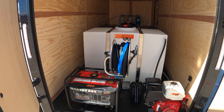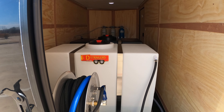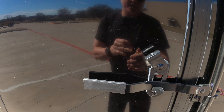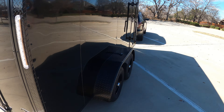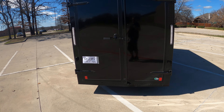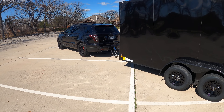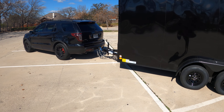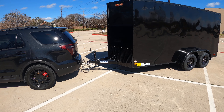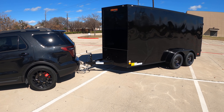This trailer you can probably tow with just about any sport utility or pickup truck, as long as it's half-ton or better — any 1500 or F-150, any Tahoe, the bigger SUVs. It's probably going to be a little too much for the smaller trucks like a Ranger or a Colorado. Those would probably tow it, because they're rated for around 5,500–6,000 pounds. I have an Explorer but I'm towing it without any water in it. When this thing's full of water, tack on another 3,500 pounds — it probably tips the scale at close to 5,500, maybe 6,000 pounds.